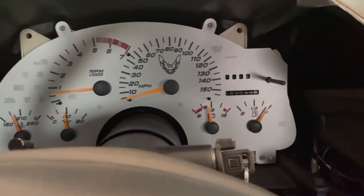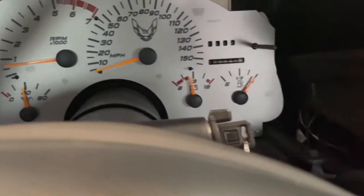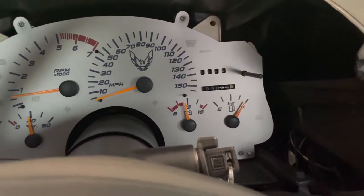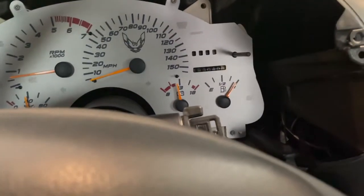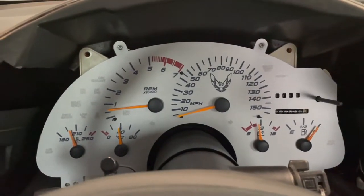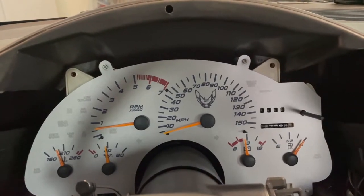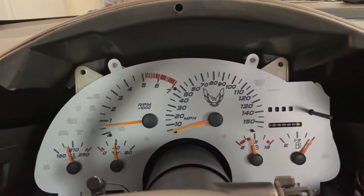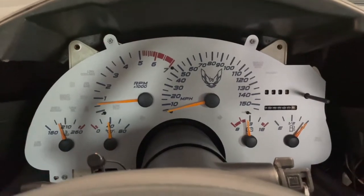Oil pressure, or battery volts, like 12.7, a little bit below 13, and then your fuel. They recommend, obviously, a full tank of fuel, which I basically did, I was just a tad under the full mark, but get that pretty close, your tachometer, and then I'm actually going to just drive down the street a little bit just to make sure that the speedometer looks correct.